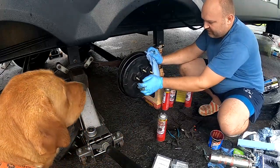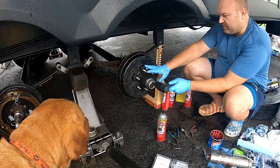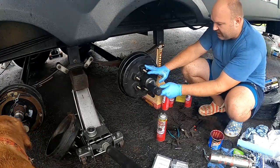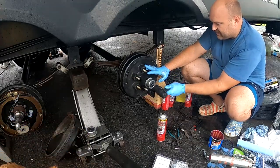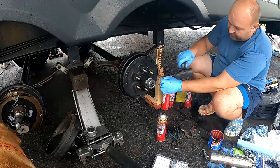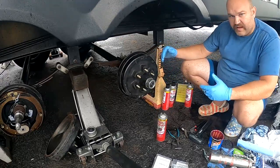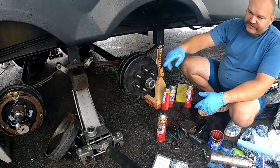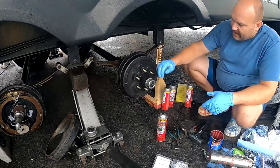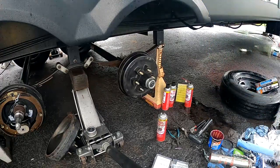We're going to clean up the grease left inside our little hubcaps, line that up, and put them back. If these are previously installed caps, they should go in pretty easy — if you have to replace a cap, new ones can be tricky to get started. Always use a soft mallet like a dead blow or rubber mallet, and go all the way around 360 degrees until you see them stop moving. Hopefully these brakes are going to work a lot better now that they're not coated in grease. I'm going to go ahead and finish up the second one the same way, put our tire back on, and torque it to spec.